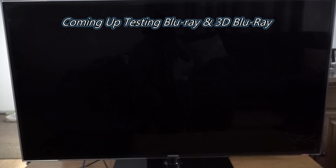But we can use an external app, and I've got a Blu-ray player that will let me use apps on this TV as well, so I can do it that way. So there's no issue using the TV. So second time round, it took around an hour for it to reset. I had to go through the same process of pressing that on off button and the volume down button to get it to reboot. And eventually it did reboot. I had to leave it and it just did it itself again. So now second time round, it's working again.